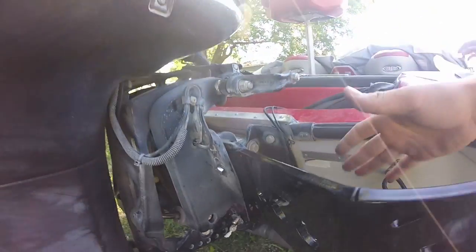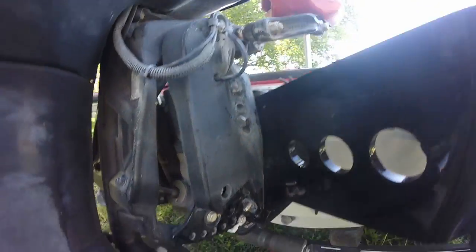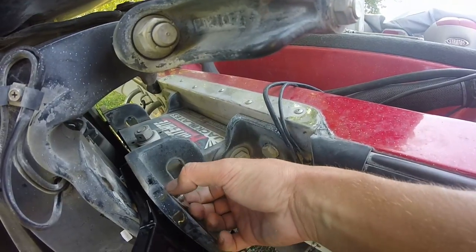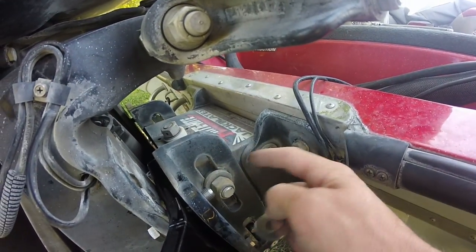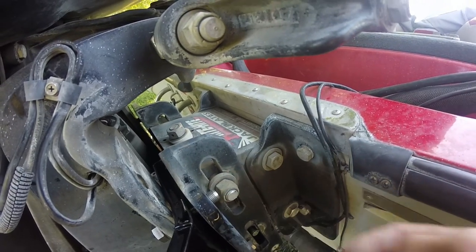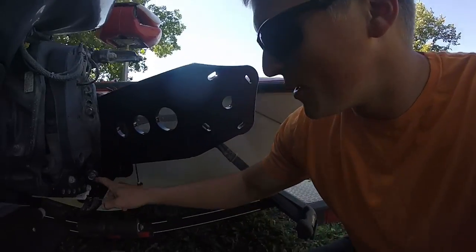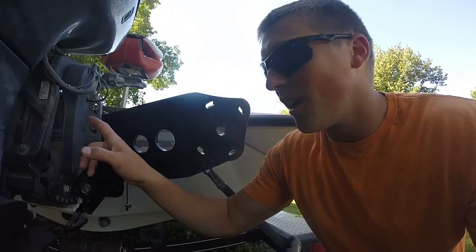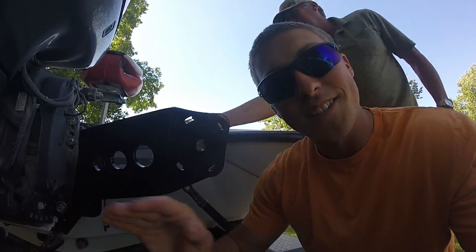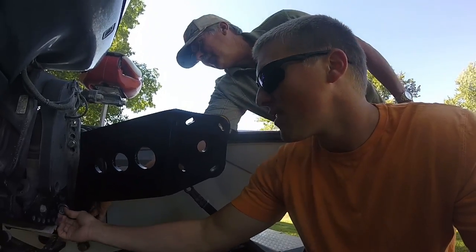There's also another little bracket you got to put on the other side to balance it out so your motor is sitting flush. We got the bolts through the same slots, and we got a washer on the head side. Now we're going to put a new washer on the nut side, and we also need anti-seize on these bolts because we're putting stainless steel to stainless steel — it'll seize up on you if you don't use anti-seize.